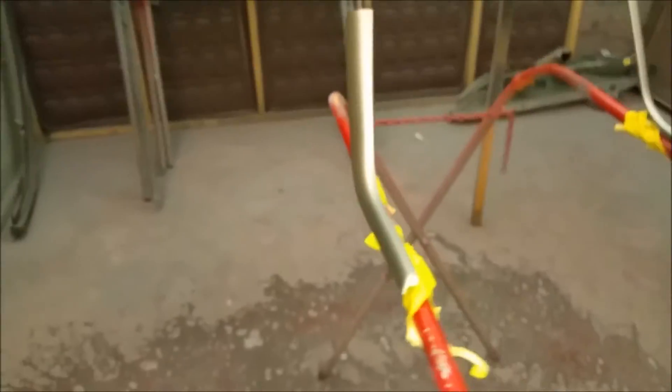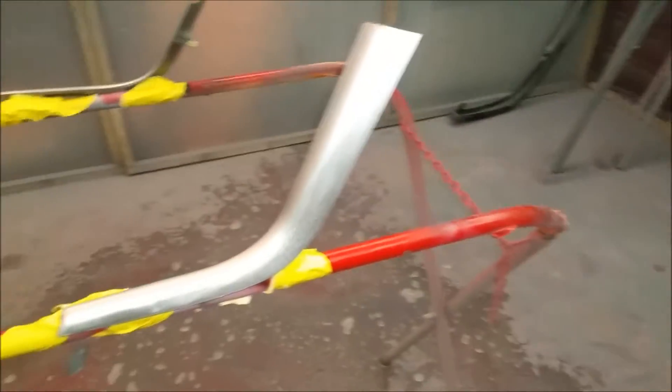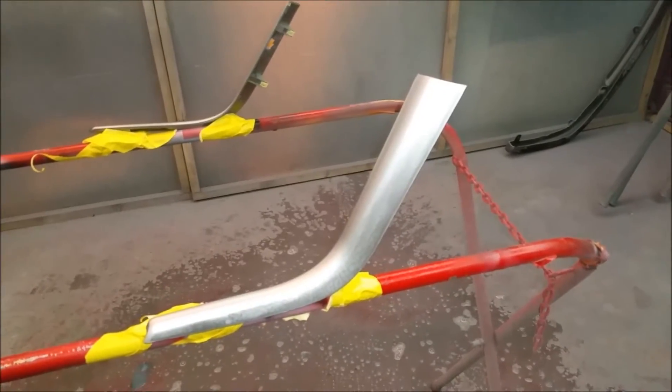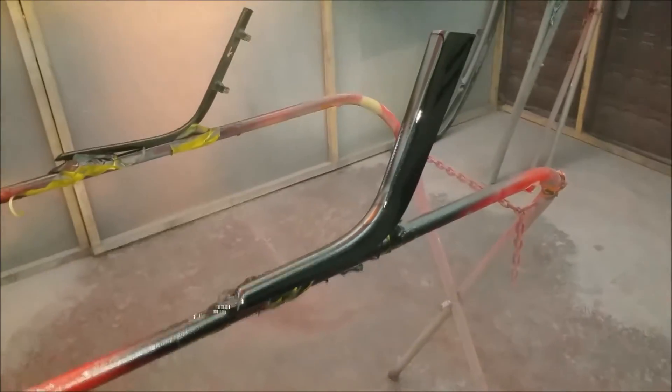I've got the pieces taped on the stand here. The surface is really good, so I just did 400 grit and gray scotch bright. Don't forget to use your plastic adhesion promoter before you paint it. Here they are all done — the paint covered really well. I only needed two coats, but I put a third coat on just in case. For the clear, I had some RALCAN clear left over and I just sprayed that on. I put on four coats just to have a little bit of build, because it's an interior piece and you never know if you're going to hit it with your keys or anything.